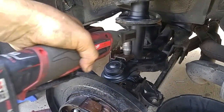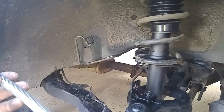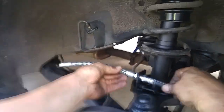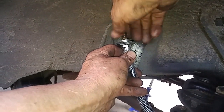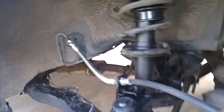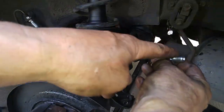When replacing hoses, the last item to tighten is the flare nut, because we want to make sure the hoses don't get twisted in the process of tightening. Push this through the hole and make sure the brake line is recessed into the new hose. Make it hand tight so you can adjust it, but the main thing you want to tighten is the end hose to the caliper.